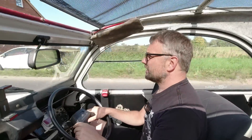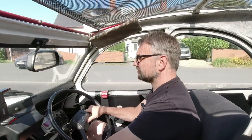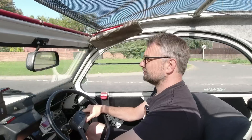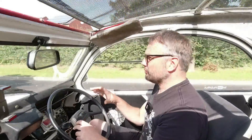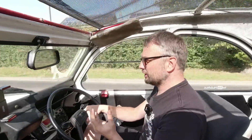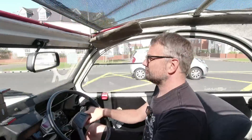She does sound happy. When Pete took her out for tuning, he noticed a rather strange sort of vibration coming from the engine. I'll see if I can make it do it now — typically it's not doing it this time. It's very slight; I doubt you'd hear it anyway. There is an odd vibration from somewhere, but Pete's conclusion after giving it much thought is it's probably the exhaust crossbox — maybe there's a loose baffle in it, and at certain revs it vibrates slightly.